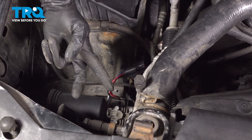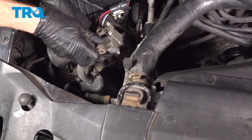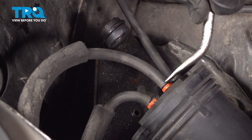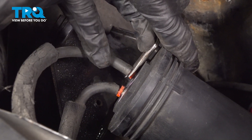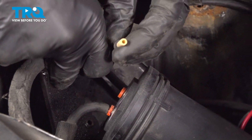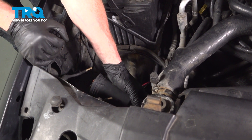Keep in mind, you do still have two hoses connected to this. It's got a little bracket that you need to slide underneath this area. Now once you have this pulled away, we can access these two hoses. To remove these two hoses, you can use a trim tool or even a small screwdriver. Carefully get up against the orange piece and press that against the compressor area. While pressing that up against there, also be pushing the hose. Once you have the whole thing pressed up against, continue on by pulling just the hose away. There's one. Do the same to the other. Once you have both of those hoses disconnected, reach in here and remove the compressor assembly.